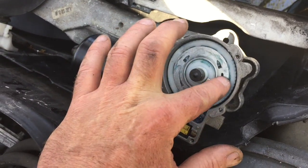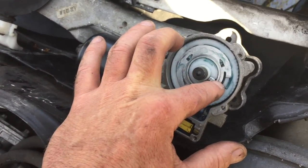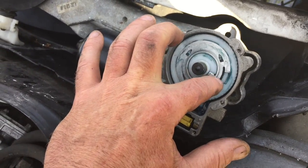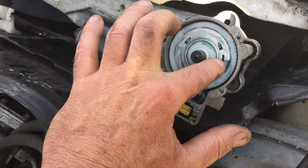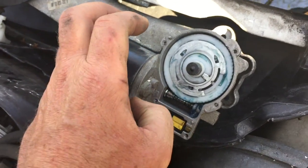It's a pretty good shot that it's going to work again. And like I said, all it was basically doing was, when it would get to this point where the contact wasn't supposed to be touching anything and continuing to go, the grease had enough filed down metallic particles in it to make contact with the metal part, and it just continued to go. So anyway, thanks for watching.